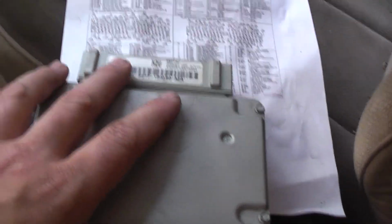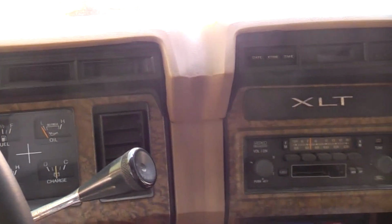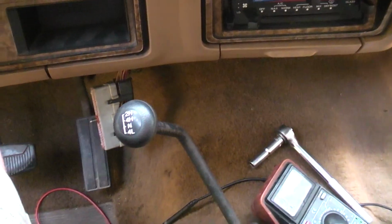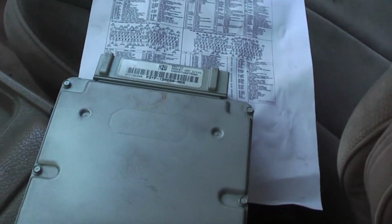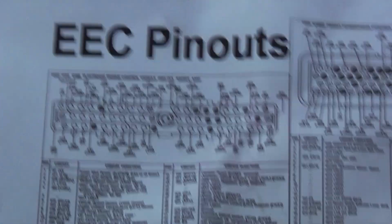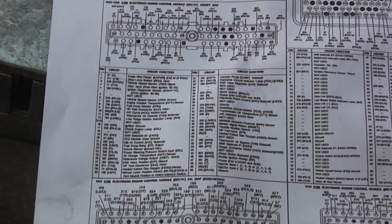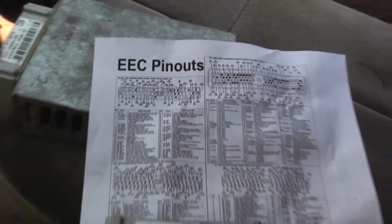I am stumped. This truck really didn't have anything too crazy done with it besides just plopping in the replacement engine. I didn't do too much with the wiring besides that TFI, like I explained. Did I get another bad computer? I mean, what is so special about this computer for the E4OD? Operationally, it should be exactly the same. There shouldn't be anything keeping this from at least turning on. But it's doing the same thing.